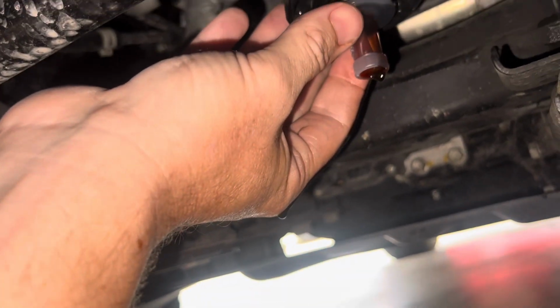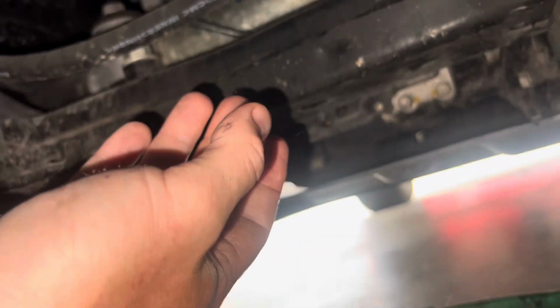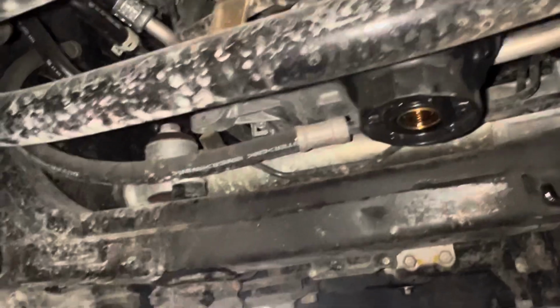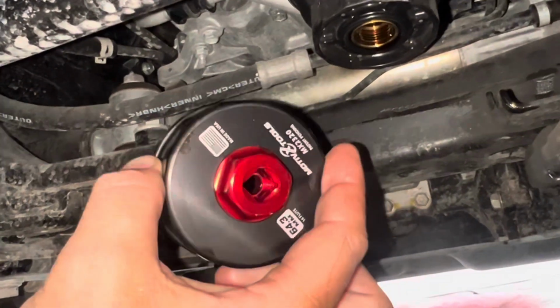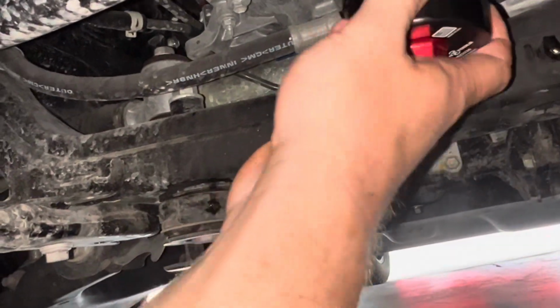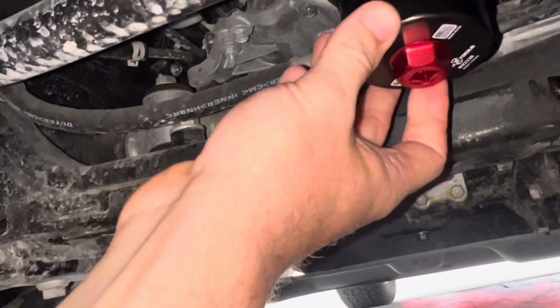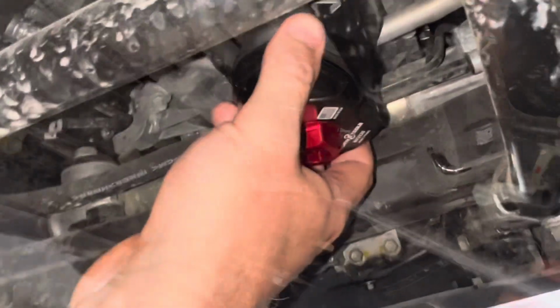And then I'm gonna use 2 hands so we can actually get in there and drain the oil. All right, we have drained the oil filter. Now we're gonna use the supplied socket that we bought from Amazon, and we're pretty much just gonna slide this on. It fits really nice. And we're gonna take off the whole cartridge from the bottom.